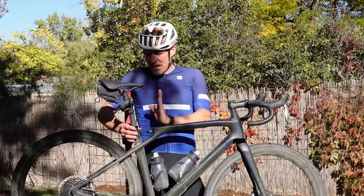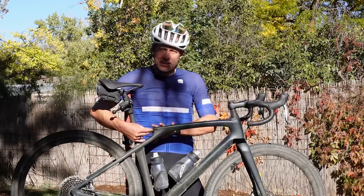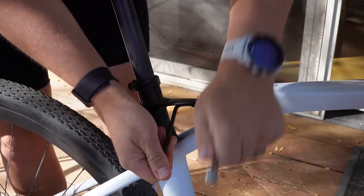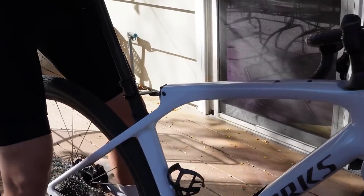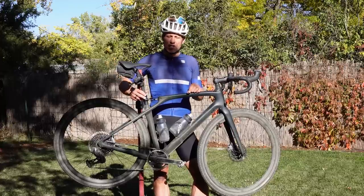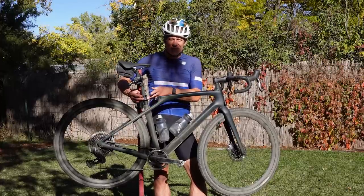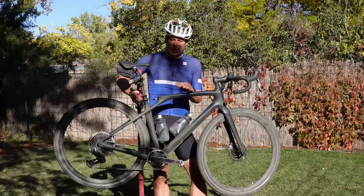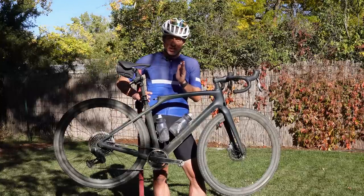To show how much the seat post and frame post move without this, Stu undid the tendon's main joint for me, and sure enough, this thing does move around quite a bit. Another thing that is adjustable is the frame post. Specialized has a total of 9 of these. 2 are reserved for the smallest size, the other 7 are interchangeable amongst the rest, each of which has a certain amount of carbon flex built in two ways.